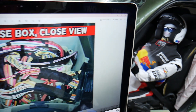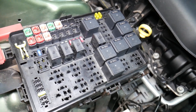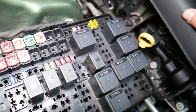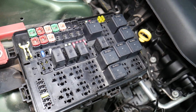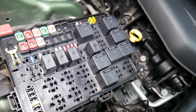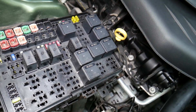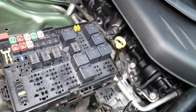Before we continue, let's explain why it's important to test fuses and relays. It is super important to always test them — here's a common mistake people make: sometimes you may think a fuse is good, or you cannot clearly see if it's burned. In that case, you may put it back and end up spending money and time on parts you don't need. All you have to do is test the fuse. We'll put a link in the description below on how to test fuses — it takes only a few seconds. The same goes for relays, which can be really expensive on these cars. We'll link how to test relays as well. For some certain fuses, it's important to disconnect the car battery when removing them, otherwise you can burn the electronics.